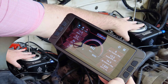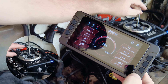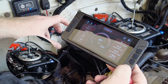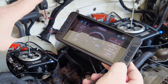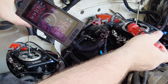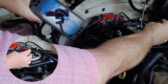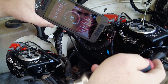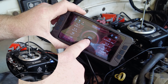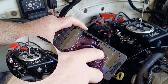Ever so slightly — look at that, see it's starting to open up more and more. So we know that we're right on the edge of being properly adjusted. I can back this throttle linkage out just a little bit — that quarter turn I put in — and we'll be right on target. That was actually about an eighth of a turn.